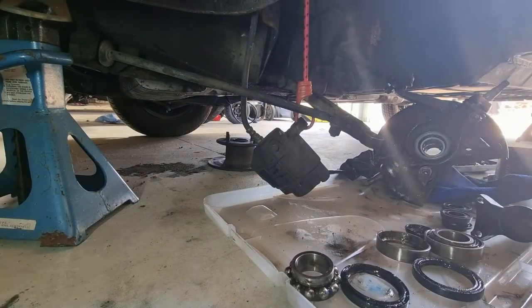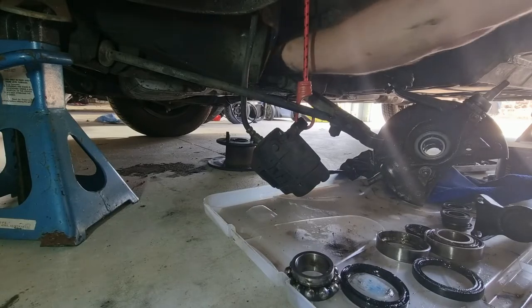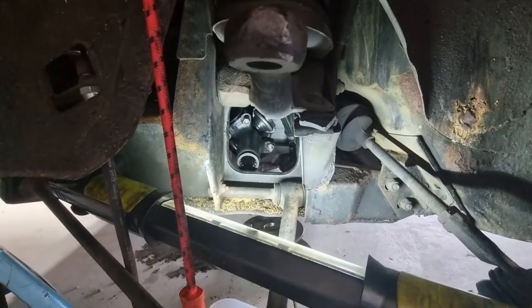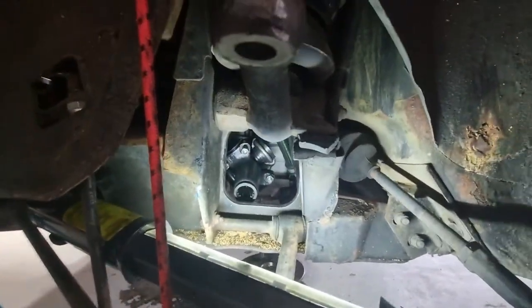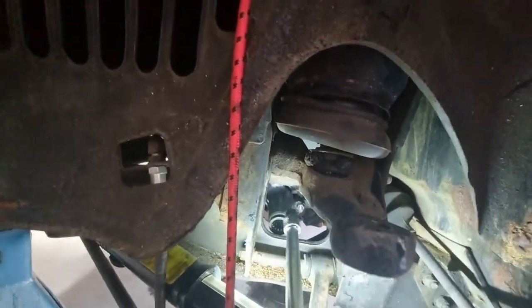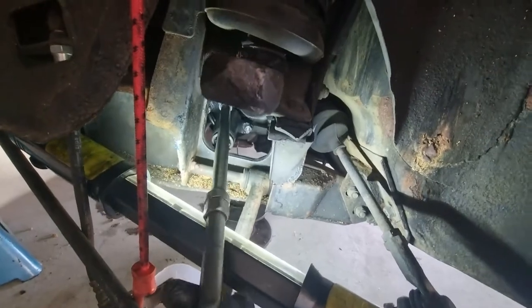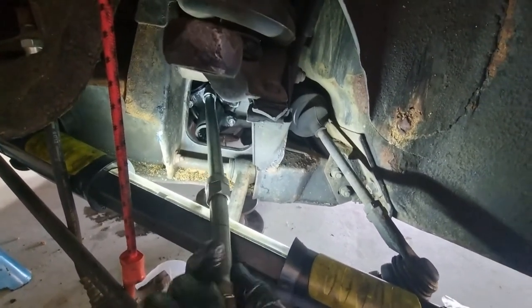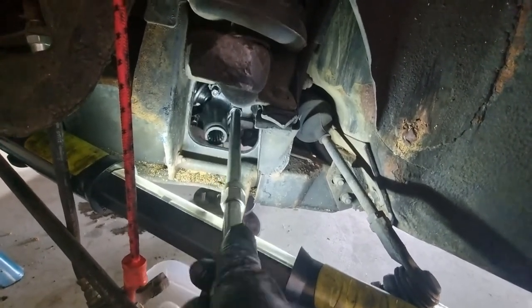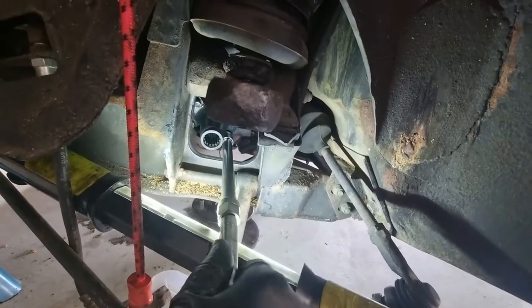Just a little dab of grease — just do try not to drop them. The last thing I want is any contamination in there. I've got a work in progress here. I was able to get the u-bolts on. It was a little bit tricky — I'll be completely honest. I'm going to tighten by hand. The secret here was dropping the gearbox into neutral so it can turn and you can get the optimum angle. I'll drop it back into gear when I go to tighten these properly, but they don't need a lot of torque.